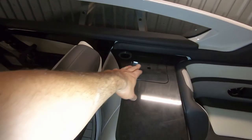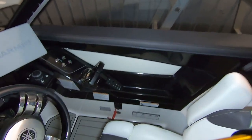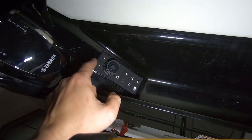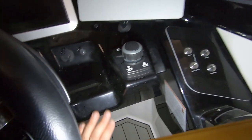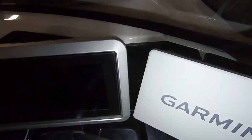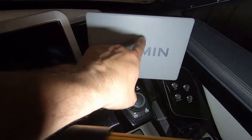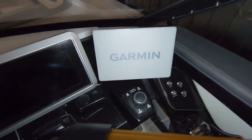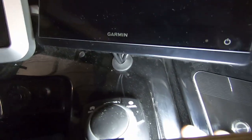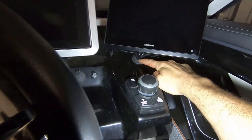After that it's fairly easy — everything goes behind this cooler through this tunnel, which actually has double space between the outer and inner walls, so you can just run wires through there. I did install the remote for the thermal camera here — this is the only place it could fit. I cut the hole out and ran the wires for it. There was another spot I considered, but it wouldn't fit there. The original phone holder was removed; you can see the holes that remain — I put plugs in those two, and the rest are covered by the Garmin frame.